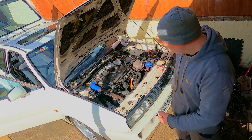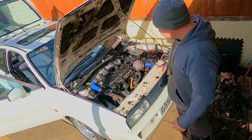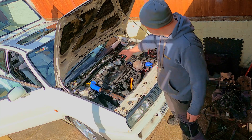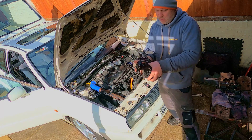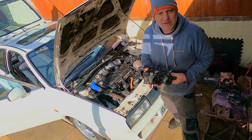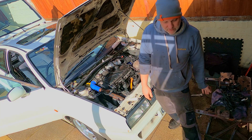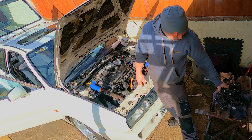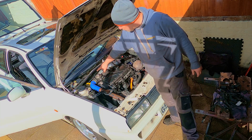Welcome back to the TDI project — a 130pd being converted into an ice retro Corrado. Next job is to sort out the vacuum lines, which normally sit at the back of the engine bay like a big jungle of spaghetti. What I'm doing slightly differently, and probably against most people's approach to modification, is keeping everything as it is. I need the functionality on the EGR valve and I want the shutoff valve to be there because it's really important.